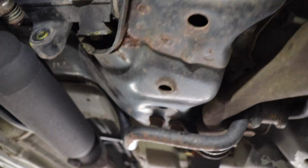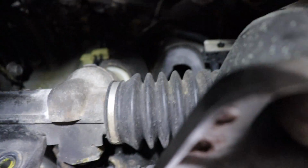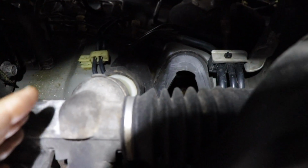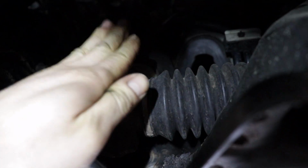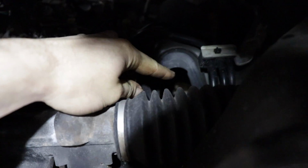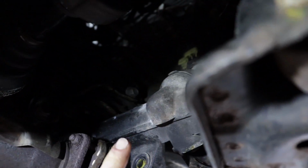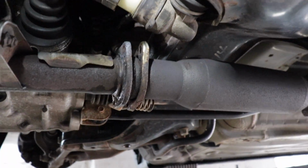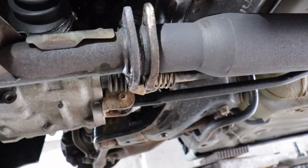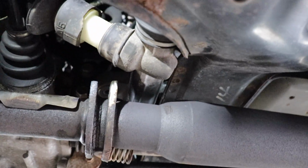So as I was saying with the shaft from the steering rack, it pretty much did just fall out. He whacked it with a hammer pretty hard and opened the joint, and then basically pulled the rack down and kind of tweaked it down in this way to get it out of the firewall there. And now we just got to wiggle it through one side and out the other. We definitely had to take the exhaust, or are going to have to. We got the spring bolts off, had to heat them. They were a little locked in there, but a little heat helped it out.